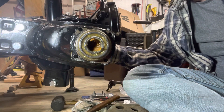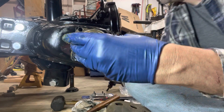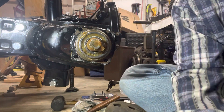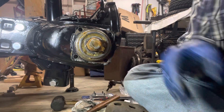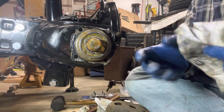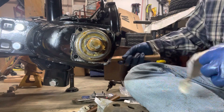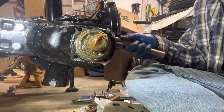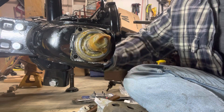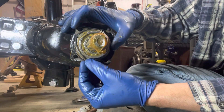Take our stub shaft and gently push it through — remember you've got that center carrier in there, this has to go through that carrier and there's a ton of grease. There it goes, start sliding through — get a lot of the bulk excess grease, put it back in your jar, save it for the other side. Try to keep your hands clean because you'll get grease everywhere if you don't — you'll go through a lot of shop towels. Then take a rubber mallet and just tap that guy home — finish tapping it through. You want it to seat right up against the back. That does feel a ton better already. With your kit, take your O-ring, slip it around the outside, and get that set right in place.